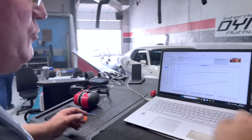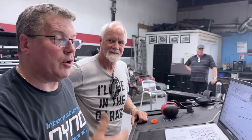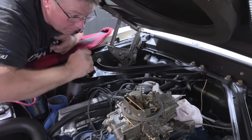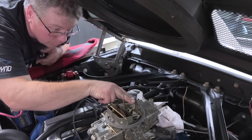It just keeps making more power every time he drives it. Before this last pass we changed the timing — it was at 10 and 28, and max timing on this engine should be 38, but it's a 10.5:1 compression engine, so at 91 octane from the pump it's not going to be very happy. We put the filter back on and made more power. We got it cleaned up a little bit more. We made 354 foot-pounds and around 258 horsepower at one point, but we were cutting runs off at 3,800 RPM to see where the smoke starts — it's right there, a cloud starts just after. So now we're taking the rear float bowl and rear metering block off to access the rear main jets, because we still have too much fuel there and haven't touched that part yet.